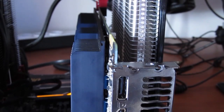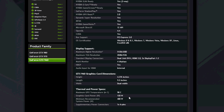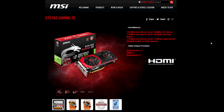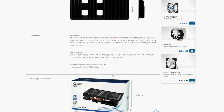The GTX 960 sits right on the border with its 120W TDP, as the S3 cooler supports up to 135W for completely passive cooling. That's likely why we were seeing slightly higher temperatures, plus the fact that the MSI model is factory overclocked. Between the 135W and 200W mark, it's recommended to use Arctic's Turbo Module or DIY a fan onto it.